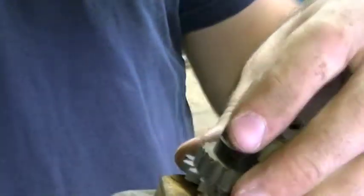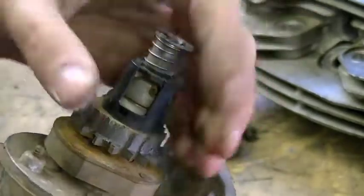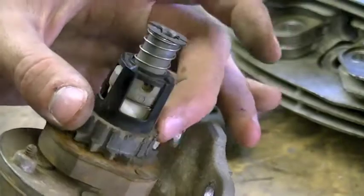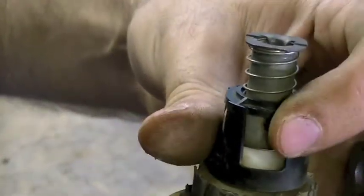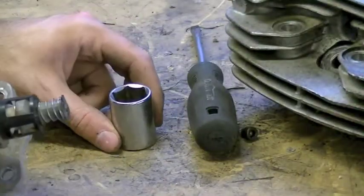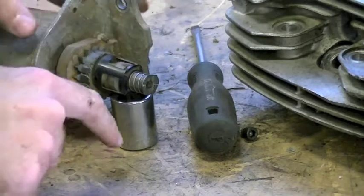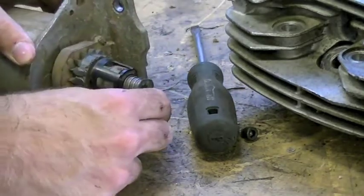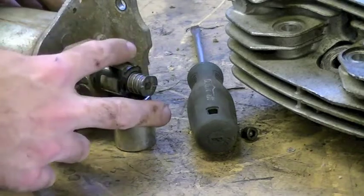The first step is to take the gear assembly off the starter. Kits often come with a complete assembly — a new top piece, new green gear, and all assembled parts. To get this apart, there's a little roll pin in here. To remove the roll pin, you take a socket, set it up so the pin is pointing down, and drive the pin out into the opening on your socket. Once the pin is out, the top assembly should come off.